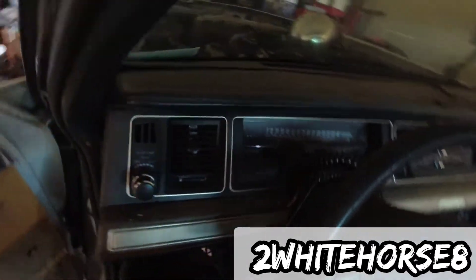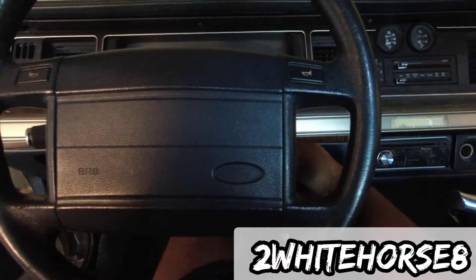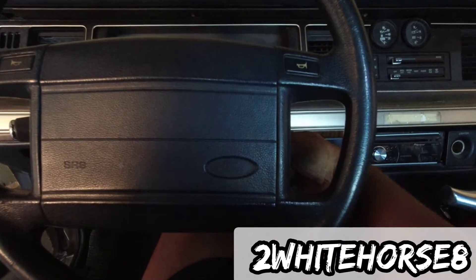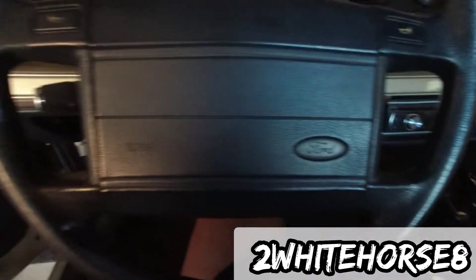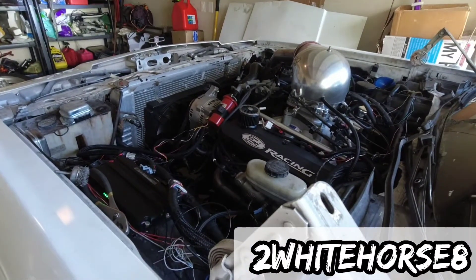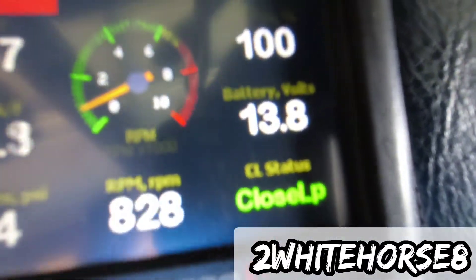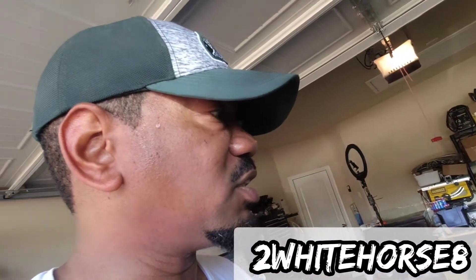It's in now. Let's see if we can crank this thing up and see if it's charging. I guess I messed up this battery — I can't even get it to jump. After charging the battery, the motor cranked and it's running. It would appear that the alternator is doing its thing — it's up here at 13.8 volts. I think we got this problem fixed and good.